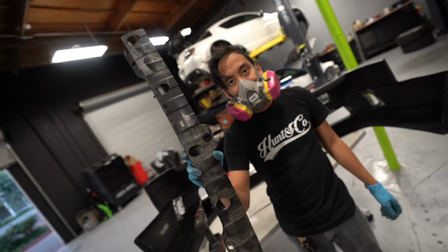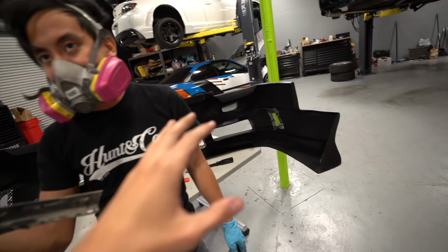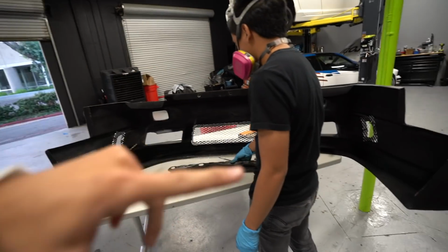Should. Calvin and I are finding the placement for this front bumper because it's actually gonna be a little bit tricky. And when I say that, I mean, the 240 uses a bunch of supporting brackets to connect the front bumper to the front end of the car. This being one of them. So not only do we have to drill holes for the front bumper, we also have to drill holes for the supporting pieces to the front bumper. So it's really just adding a step of complication because we need to micromanage a bunch of other holes to make everything align itself.